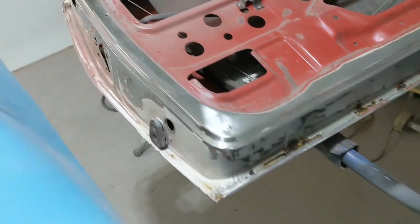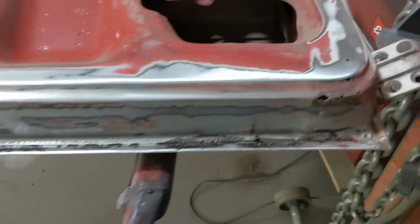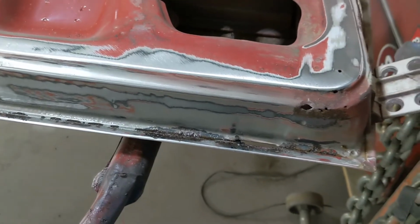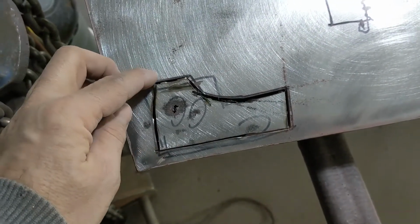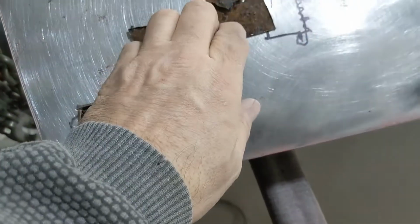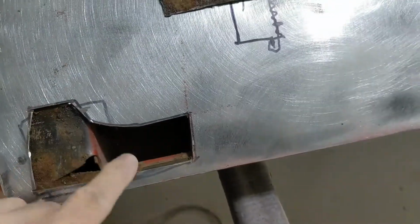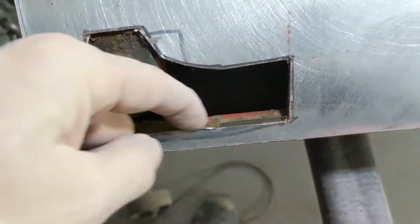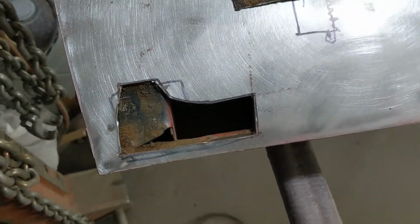So we stripped back most of this door frame and got a little rust neutralizer on a few of those little surface spots there, but we did get this one little area here that we're going to do a little repair on. And yeah, we did cut out a little patch on the other side, and I'll show you that. Here's the little patch on the door that we've cut out because of this little hole, little bits of rust. And once we get that out, you can see how it starts on the back. So we'll put this one in there. We'll get this a little more cleaned up, get some primer on that, and do some rust prevention in there. See if we can get more of that out with a wire wheel and get it stopped in its tracks for another 25, 30 years, maybe more.